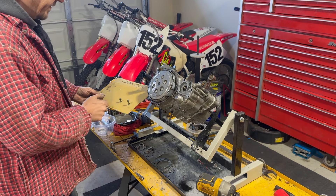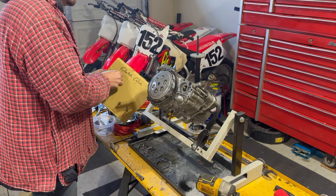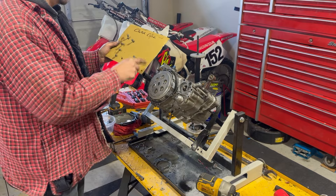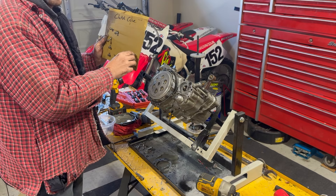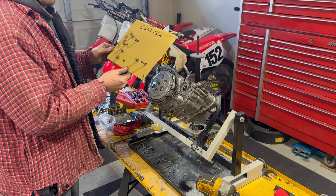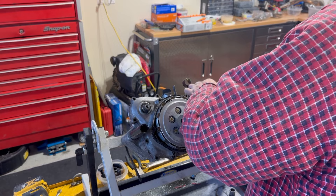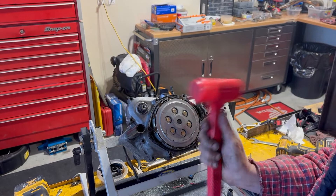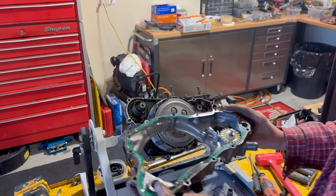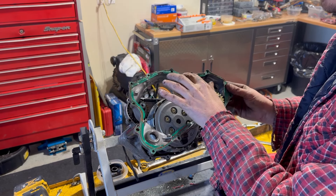Now, because this bike is so out of whack with the way the bolts are and the silicone and stuff, what you can do is go to a website like Partzilla — they'll have an explosion view of the cover and all the bolts. It'll tell you it's a number six thread bolt and it's 20 millimeters long, or whatever it needs to be, and then you can measure the bolts to make sure they're the right length. The silicone is going to be a bit of a fight. Just give light taps with a dead blow hammer, not a steel hammer, allowing it to pull apart. You can see that the silicone did nothing but create a problem.